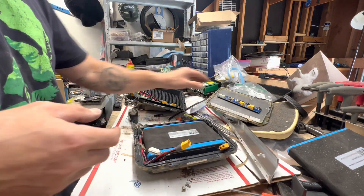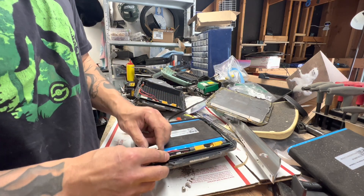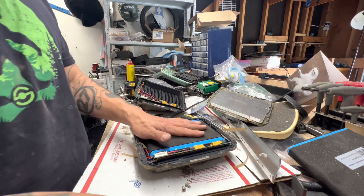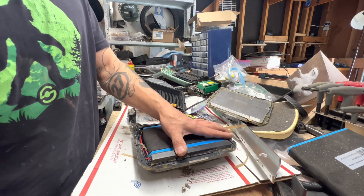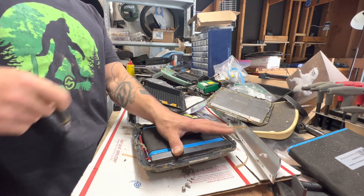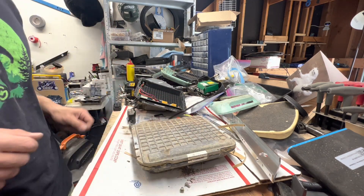Then go ahead and put it all back in there. Put the BMS back in there, put all the leads in from the board first — all you have to remember is put the yellow in first, put the white in last. After that, close it all back up and put all the screws back in where they're supposed to go. You are now much better protected than you used to be in your Pint X. I hope that everybody got a little bit out of this, and good luck fixing your Pint X. If you don't think you can do it yourself, bring it to me.